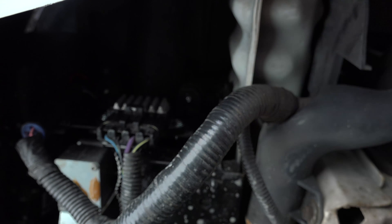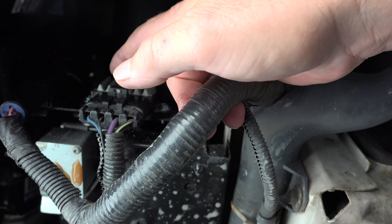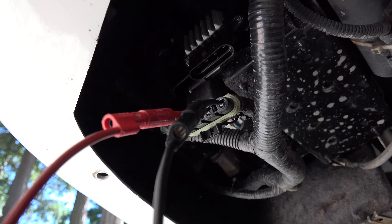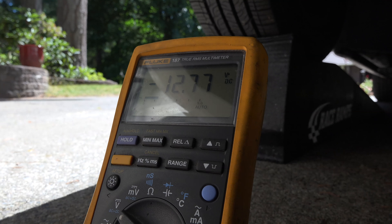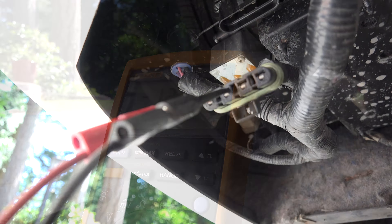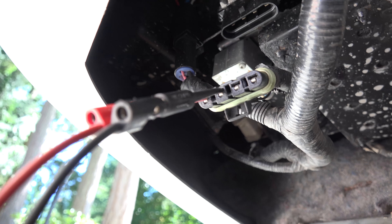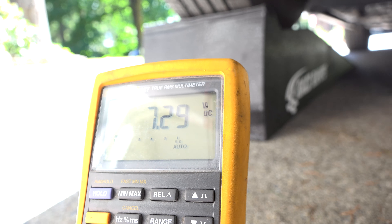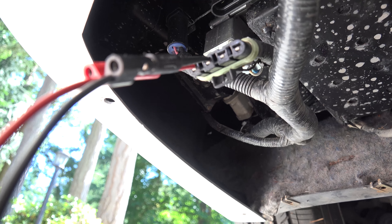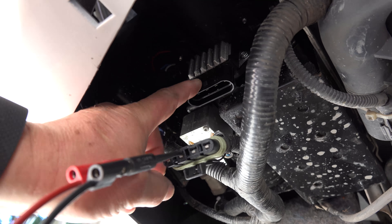Could be the black, but one of those two is probably the 12 volt. And if this relay has gone out, then it's not going to run. So I'm going to disconnect this and check for 12 volts here. Well, I've got them both hooked up and I was wrong — the purple is actually ground, reading minus 12 and a half volts, but that's because I've got the leads reversed. I swapped my jumpers over to the other two pins, which are the leads coming from the computer, and I know the computer is telling it to run right now because it's showing seven and a half volts. The computer will stay on for about an hour after the ignition is off, but that confirms the computer is working correctly. I've got power to this connector for the compressor.